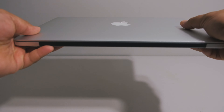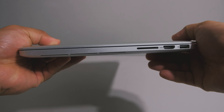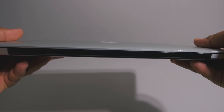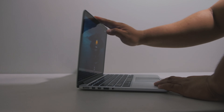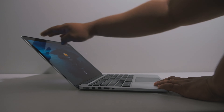The first thing we need to check in the MacBook is its cosmetic condition. Make sure everything is fine and check if there are any issues not indicated in the listing. As we open the laptop, check the hinge if it's loose — make sure it is tight and can hold its position at any angle. Check as well if there are any scratches on the screen, because the pictures posted in the listing aren't always the best, and the Retina screen in general is very expensive to replace.